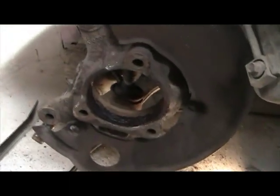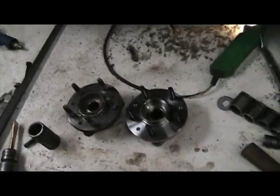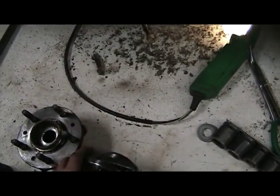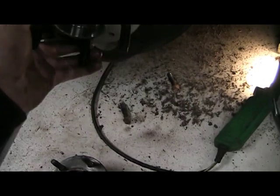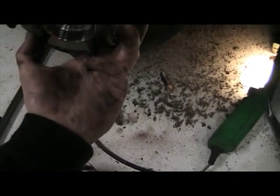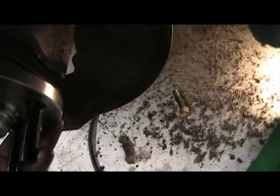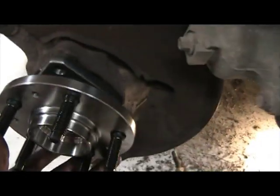We don't need to go clear back inside, just where that bearing's going to ride. Should be good. There's our new one, so we'll get that one put in there. You've got to watch out where she goes — make sure all of your bolt holes line up. That one's good, that one's good there. Get them bolted in.